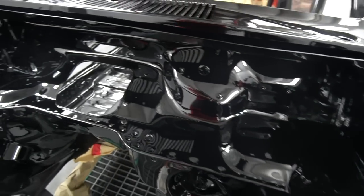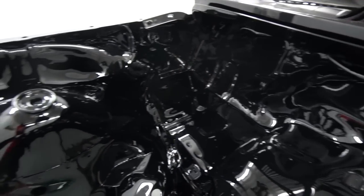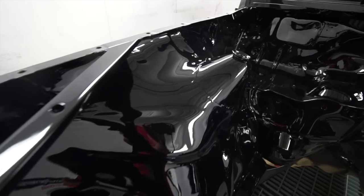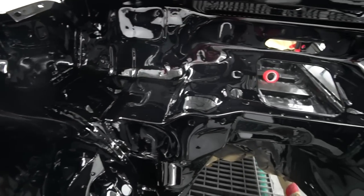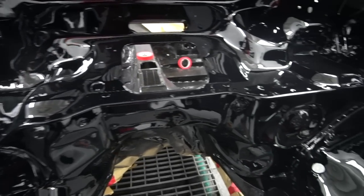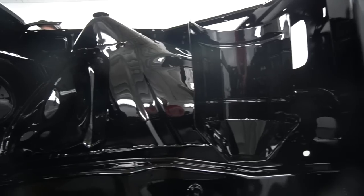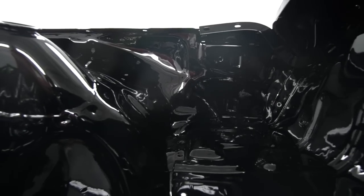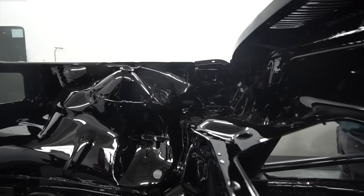The body panels have all been mocked up on that, bear in mind, at this stage. They've all been on that up to as far as the final epoxy primer coat, so they were only a wet blocking away from their final gaps, i.e. the final gaps are all set. So the fact that the panels aren't with the shell at the moment doesn't really matter from a gaps point of view. We know all that will go back together as intended. So the body shell is now going to progress through and go to assembly so that we can get that rolling, and then that can go to Simpson Race Exhausts for the exhaust fabrication work. In the meantime, we can do the panel prep without the car. They're almost prepped, but we'll just finish off the panel prep and get them painted. Then as soon as the car's back from Simpson, we can panel it up and finish assembling it. So that's all in hand.